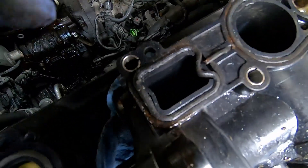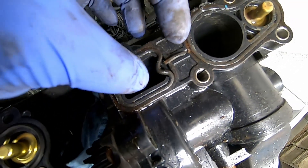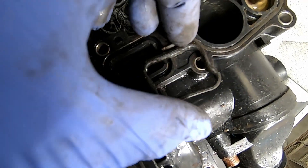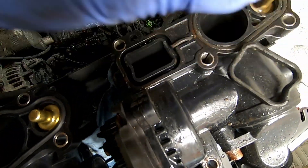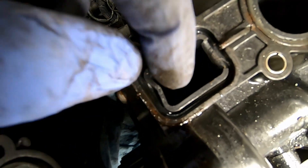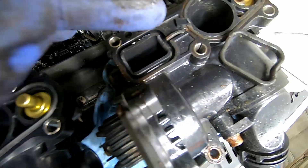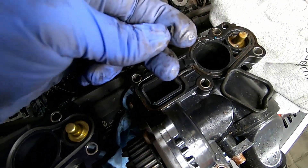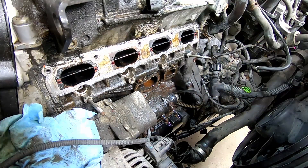It's pretty easy to see what's going on here. This is where the leak was coming from. I thought it was just a gasket thing, but let's take off the gasket — you can see how the gasket is deformed right there, and that's because the plastic is actually broken right there. On this side it's broken as well. In comparison, here's a new one so you can see the wall. This is original, so we're talking 106,000 kilometers — this plastic is clearly very brittle. Let's clean this up and install the new pump.